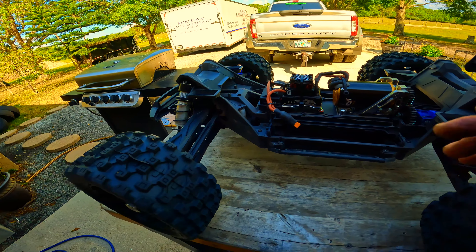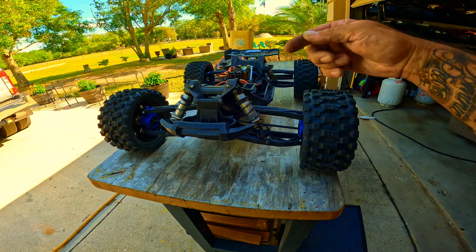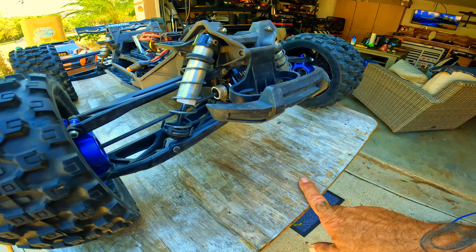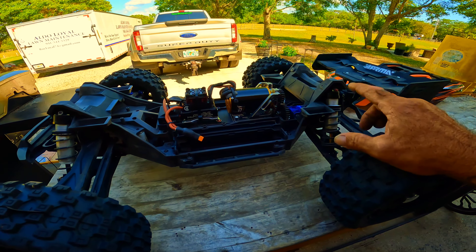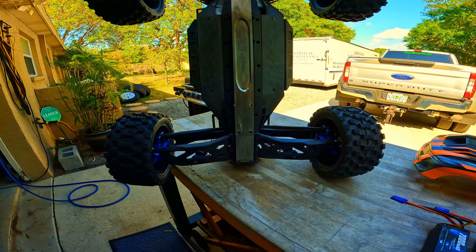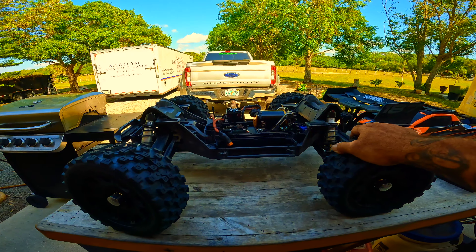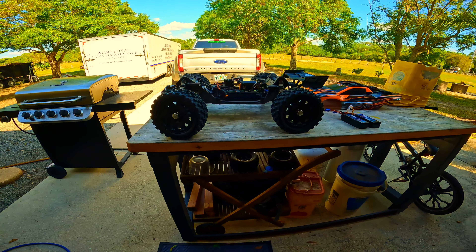Everything else held up strong — the bell crank is working fine, motor mount's awesome, wide kit's awesome, center shaft's awesome. Damages: I bent three CVDs total — two from the first run, one from the last run. Two front arms are broke, both in the same place. Running Vidavon hubs front and rear, Hot Racing cush drive cover, Hot Racing diff covers front and rear, and Hot Racing suspension plates. Running the new prototype M2C chassis brace, which I think saved my bacon — you can see the big scratch from hitting that metal drag. Got temperature issues but that's pretty much it. Gotta go do some family time — spring break here in Florida. Catch y'all on the flip side, thanks for watching, peace out.